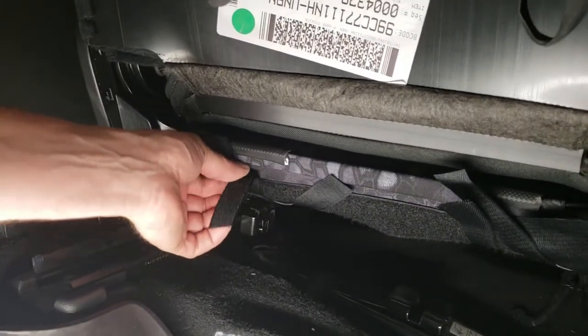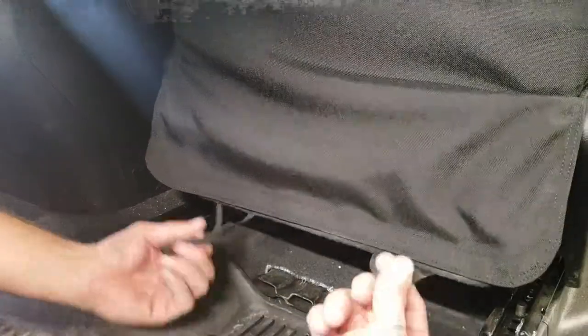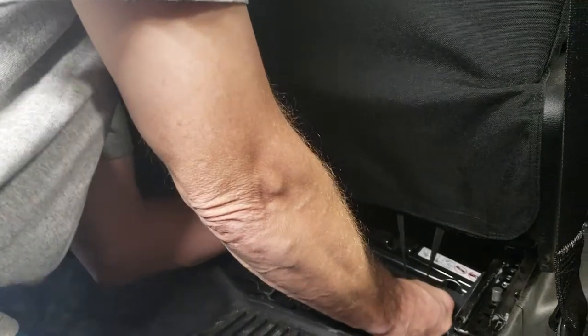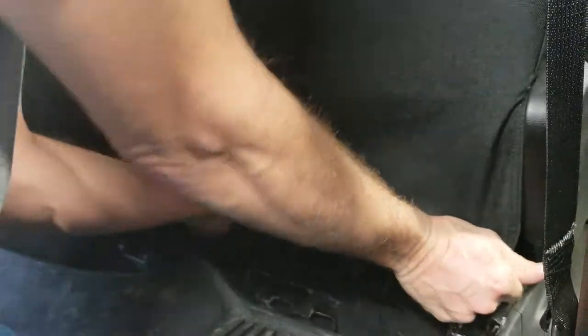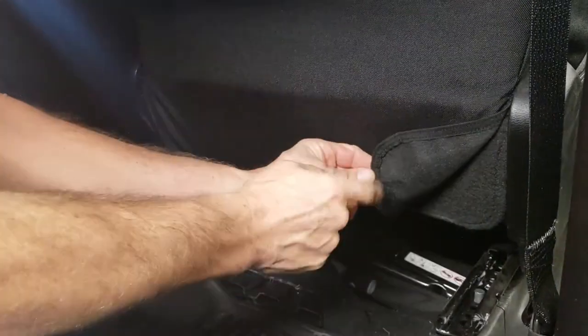Take your scissors and trim: pinch your fingers where you're going to trim, pull it away from the seat cover, trim the excess, and put it back on the seat. Connect the elastics — feel around underneath for where those hook up; they go a little to the inside. Hook that one, take it forward, hook that one — both are hooked up. Lastly, pull down on the seat cover and press the hook Velcro right into that fuzzy carpet. That's the back installation done.